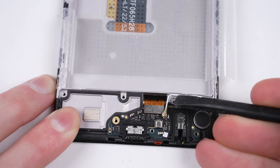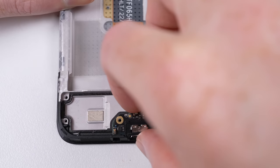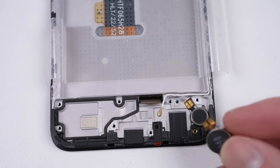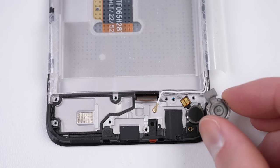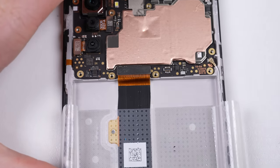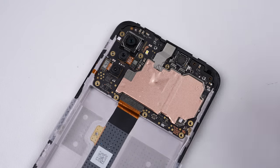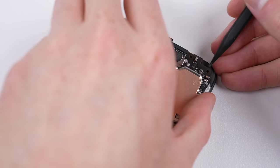Back at the bottom of the phone, we can detach the charge port and headphone jack daughterboard. Underneath is a very unimpressive vibration motor — given just how poor it is, I thought maybe I could retrofit a Samsung one in, however it's a completely different size, so it looks like we're stuck with it. Running this flex cable between the frame and back of the screen is an odd choice, especially in a phone meant for quick and easy repair. However, one positive is that a new display comes attached with the frame, easing repairs and limiting the amount of things we need to remove.